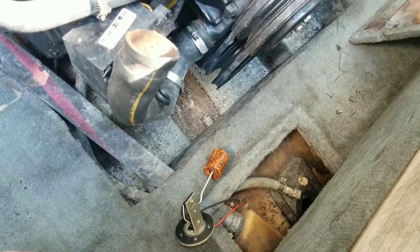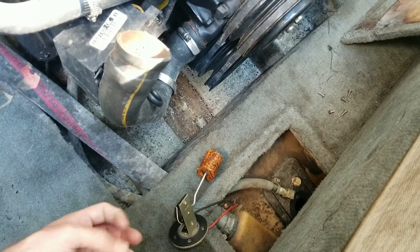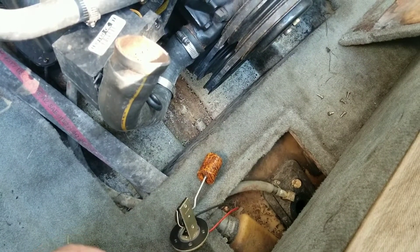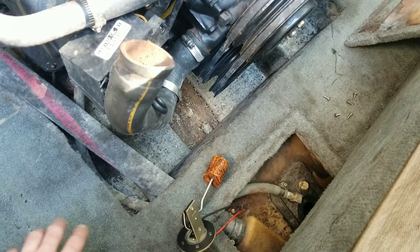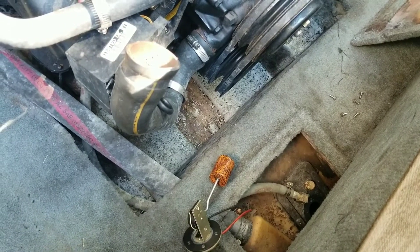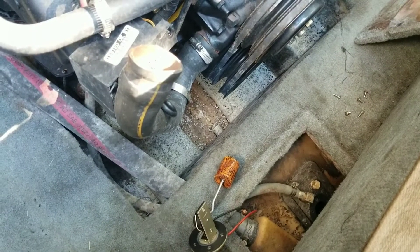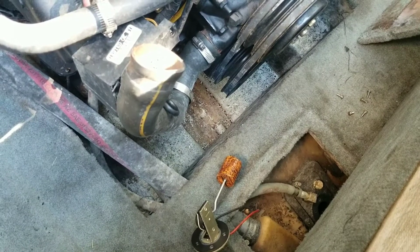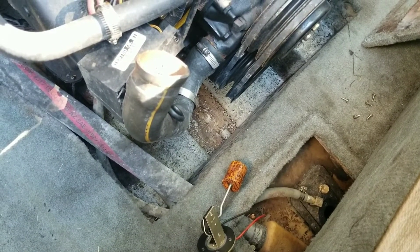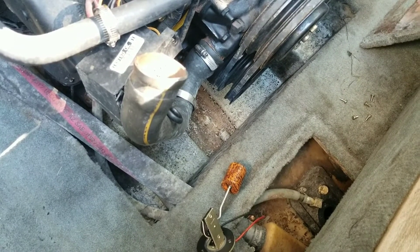So now we're in the boat. I cleaned the contacts the best I could. What I'm going to do is use my hand to manually sweep the float back and forth, and watch the gauge to make sure it can hit all ranges without jumping around too much. I've already tested it a bit and it is jumping, but I'm hoping with time it'll sand or clean those contacts a little more and work even better. It is now working — before it wasn't reading.